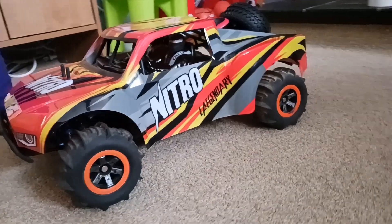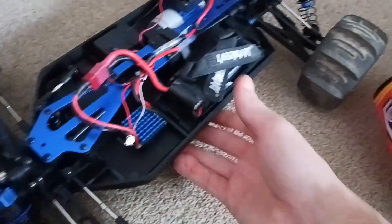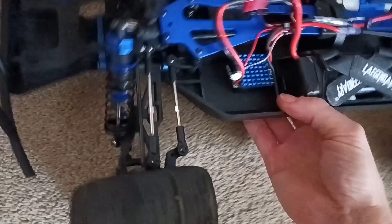Let's take a quick look before we go outside. We got the 2200 3S ADC strapped in nice and tight. I had to use 15mm spacers — that was the smallest I had. I think 10mm would have been better because the inside of the wheel was catching this tie rod mount here.